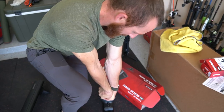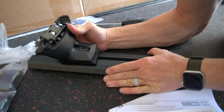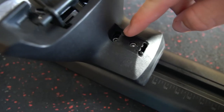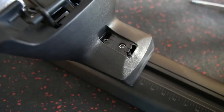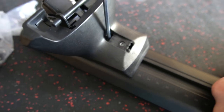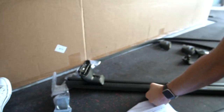The instructions say to adjust the measurement and pitch angle of the towers on the rear crossbar. For the Subaru STI the rear measurement is thirty-five and three-eighths inches. Slide it down to thirty-five and three-eighths. There's a little clip on the back side — that's the theft deterrent they have you open early in the install — now tighten this thing up at thirty-five and three-eighths.